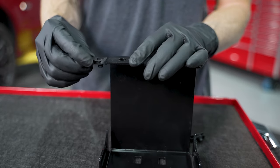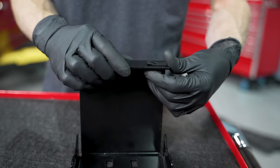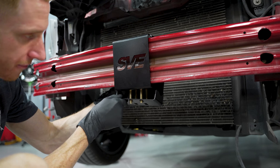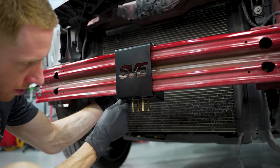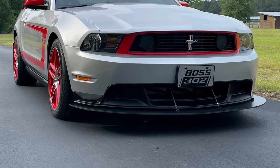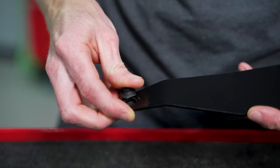Before installing the rear bracket, install the two provided speed nuts with the nose of the speed nut positioned down into the outboard locations on the bracket. Then position the rear bracket over the four bolts and swing it up around the crash bar. Loosely install the two provided flange bolts — we'll tighten these later. If your car has a Laguna Seca splitter or an aftermarket splitter that uses support rods, install the two provided splitter brackets at this time.